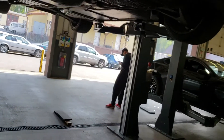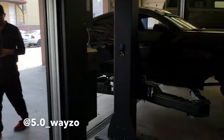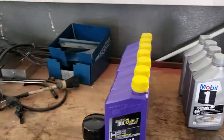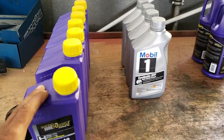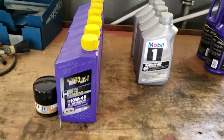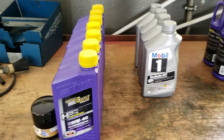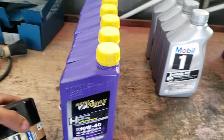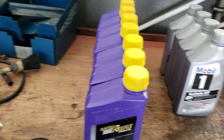The car is already up on the lift. I'm here with my friend Felix, who has a Mustang I'll be reviewing soon. For my engine oil, I'm running Royal Purple 10w40 — a little thicker than OEM recommended — because I don't have an engine oil cooler yet and I need oil that won't break down with the heat. I'm also running a Mobil 1 oil filter and I have a magnetic oil drain plug to catch any shavings.